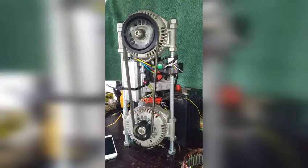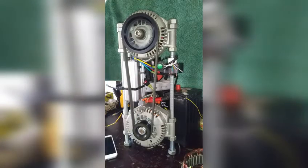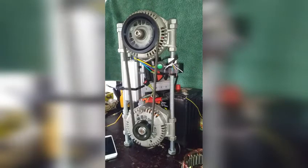At this speed this is approximately 12 volts, now approximately 24 volts. At full speed it's approximately 40 volts at less than 1 amp. That is full speed at approximately 4000 RPM. This alternator requires 4000 RPM to produce 150 amps at 14.5 volts.